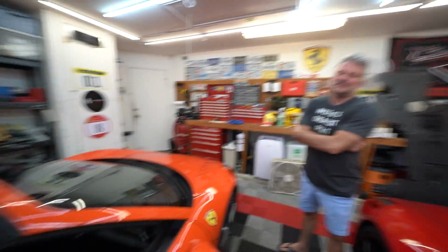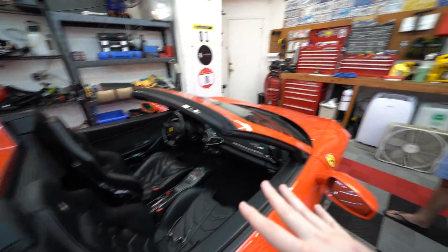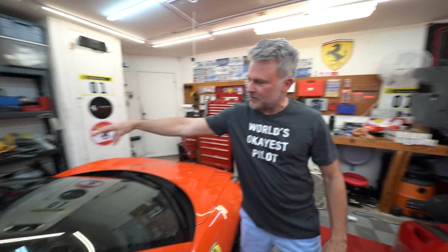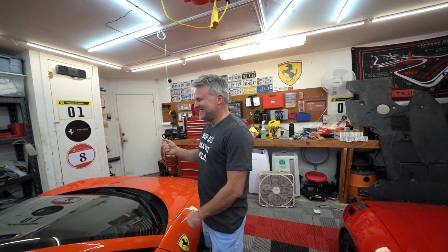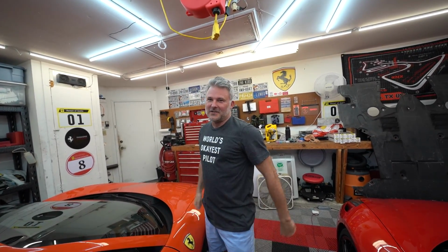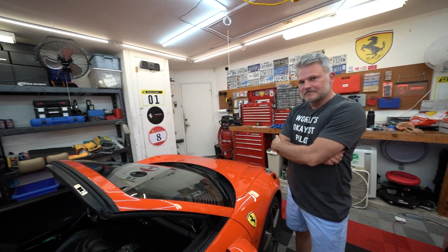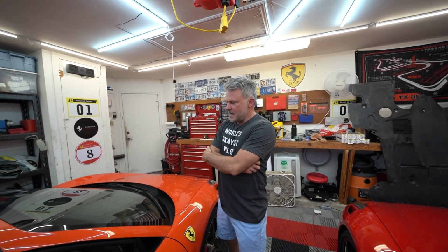Working, you know. So the big thing we need to do is use a fuse tap. And that was what you didn't have last time. So we've got the right equipment now. What I foolishly did was, in the mirror, there's a bunch of sensors and all kinds of cool wires, and I thought, there's got to be some 12 volts I can grab there and plug in my radar detector. In theory. So I'm sitting there touching wires with my little handy dandy digital voltmeter, and I crossed something that shouldn't have been touched. You probably hit one of the 12 volt lines to the communication lines, and probably sent 12 volts to one of the computers.